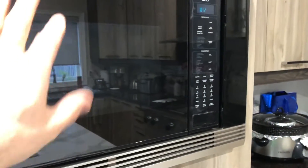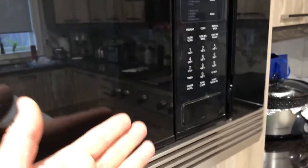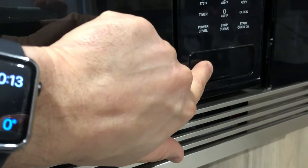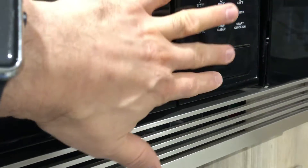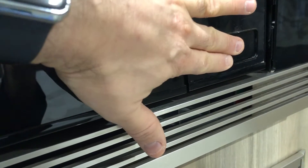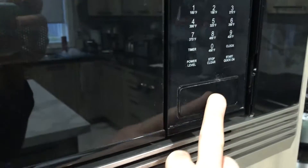So this was driving us crazy, because it would work sometimes and not other times. I open the door — sometimes it would work, sometimes it wouldn't work. It really depended on how you slam the door shut. And then I realized that if I lightly touch this, sometimes even if it's not working, I don't have to stop it and open the door and close it again — I just have to lightly depress this, and then I would see that my coil or magnetron were energized. So I knew something was flaky with this.